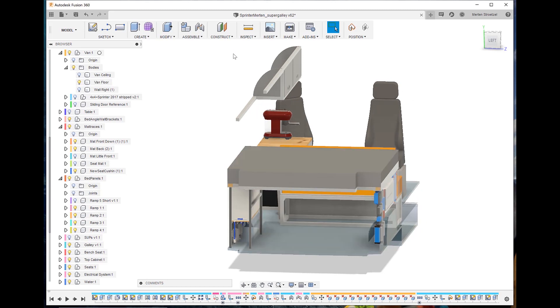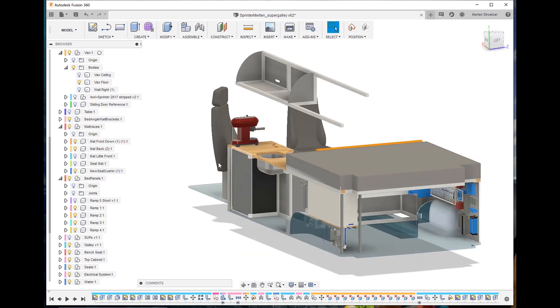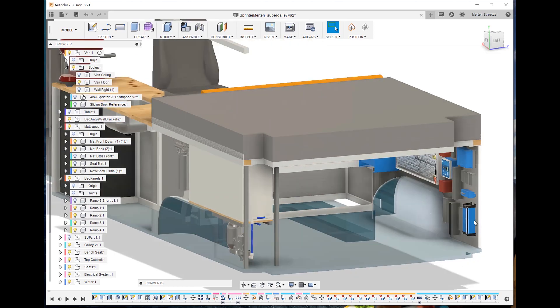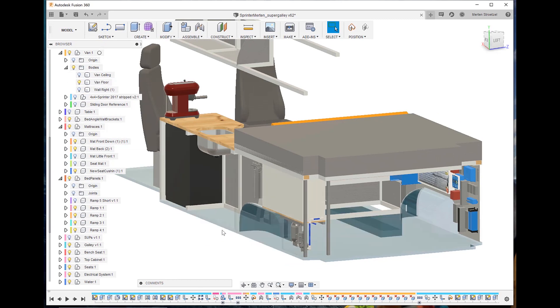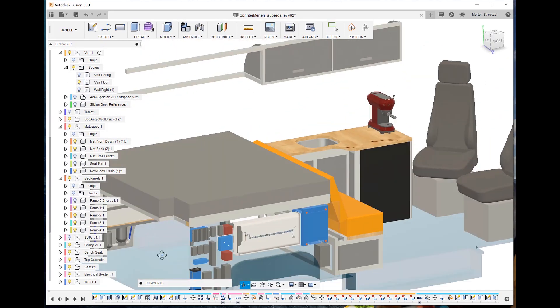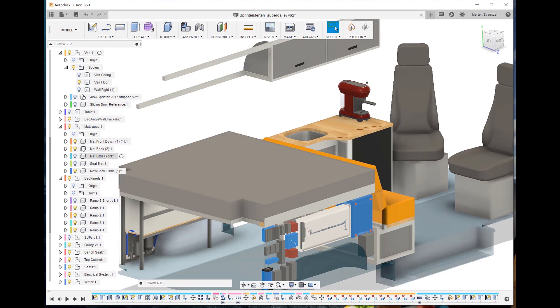Electricity is the first thing you'll have to run a lot of cables over the roof because you need things on the left side too. The fridge is connected permanently and it's a 24-volt battery system — the fridge runs off 24 volts, the inverter runs off 24 volts, and for everything that needs 12 volts I have a DC-DC converter that converts it down.